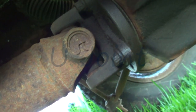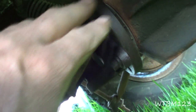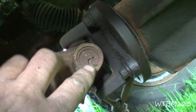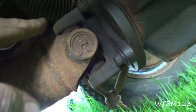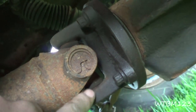It's kind of dark in here, but this is a forward driveshaft. If you see right here, you've got four bolts that you've got to take off to get it off that flange. But if you notice, the U-joint goes into this flange. So instead of just the caps bolting into it, you've got to hold another flange. So when the driveshaft comes out, you've got this driveshaft plus this piece hooked together on the U-joint.